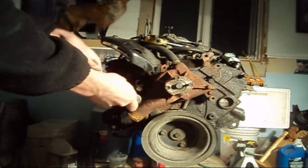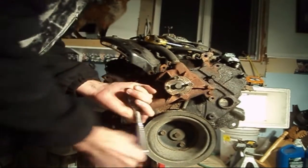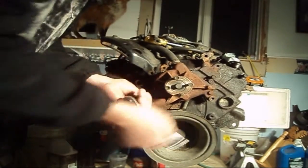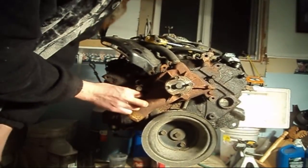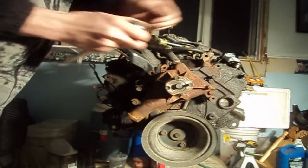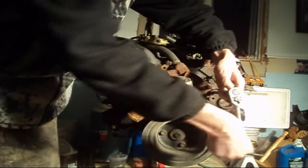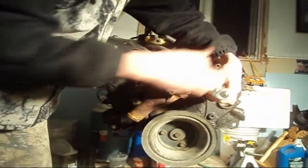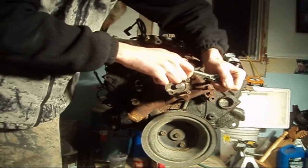There's that one, and directly below it is another. Once you remove your fan from the vehicle, you'll have adequate room to work on it. With your alternator and everything else in place, you might have to disconnect your alternator. Your power steering pump should be able to be left intact. If you do have air conditioning, you'll have to unbolt that — just the bracket, as your bracket might be interfering with the water pump. And there's a bolt up top here; they're all the same, 14mm.